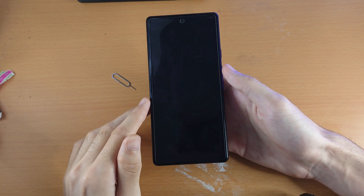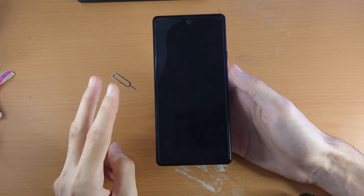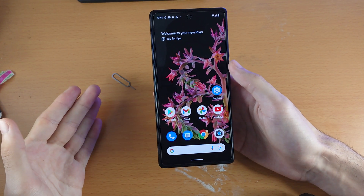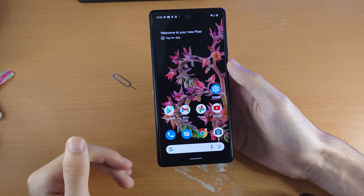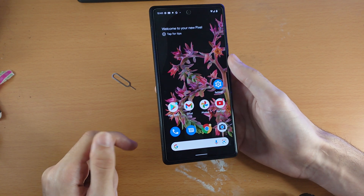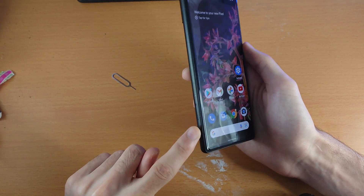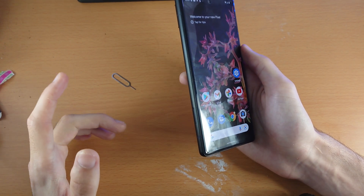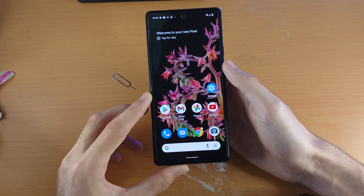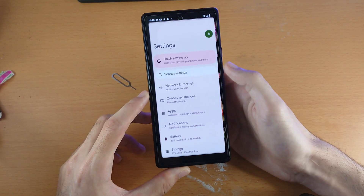You may be wondering about two SIM cards. If you want to use two, you'll need to convert a second physical SIM into an eSIM and set it up on the phone. This is because the SIM card tray only supports one physical SIM, but it also supports a second eSIM. To set up an eSIM, let's load up Settings.